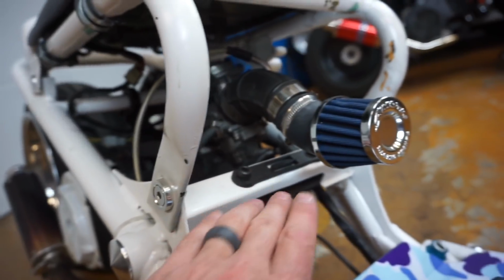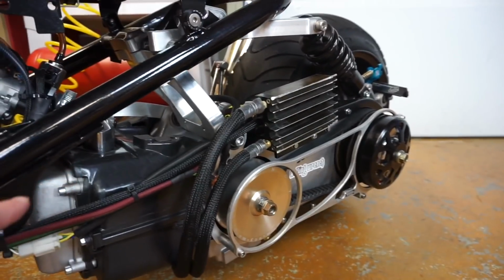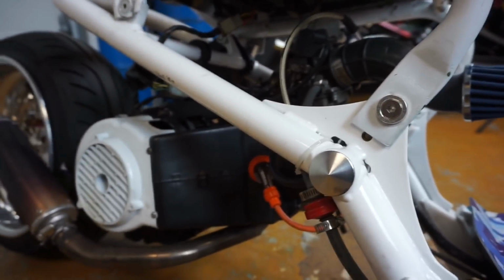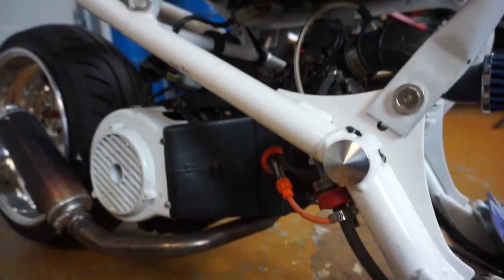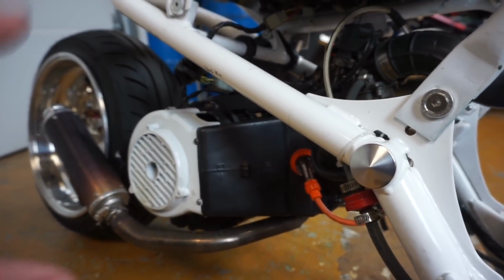I couldn't tell you right off the top, but basically you can do a larger big bore kit if you do the B motor. So like this is a 232 cc, the largest you can go on this guy. Unless you do a really large stroker crank, I believe you can do 216 cc. But with my experience, a 190 cc is like the safe biggest you can go. Both motors are extremely reliable. I've never had any problems with motors failing or anything like that. The only reason why you would go with the GY6B motor is you just want the larger displacement. And if you really want to worry about the quality, which I've not had problems with, then you can do that too.